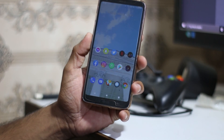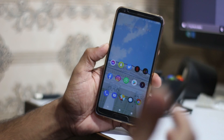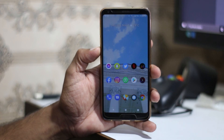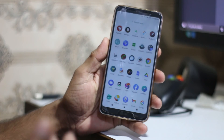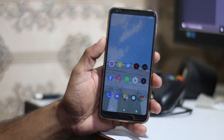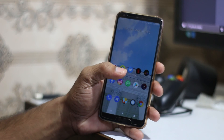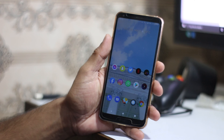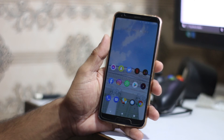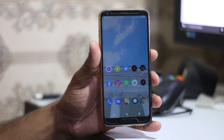We need OrangeFox recovery and Skyhawk recovery instead of TWRP recovery because the Android 11 ROMs will not work properly, or you cannot even install them without OrangeFox or Skyhawk recovery. Both are available for the same variants of the LG G6 — US997, H872, and H870 — so if you have one of these devices and have root and a custom recovery, you can install these recoveries to run Android 11 ROMs.